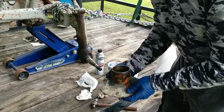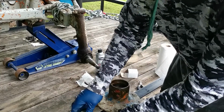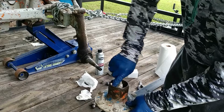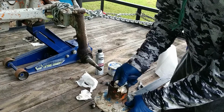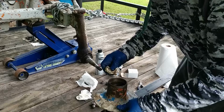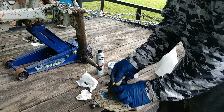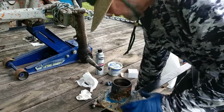Now you turn it over. You take the large race for the inner bearing. Clean all of this one last time. Make sure it's good and clean. Get any of that surface rust off of it from that rain. Make sure all the edges in there are clean. You don't want it to go down there and seat against something and not be able to fully seat.